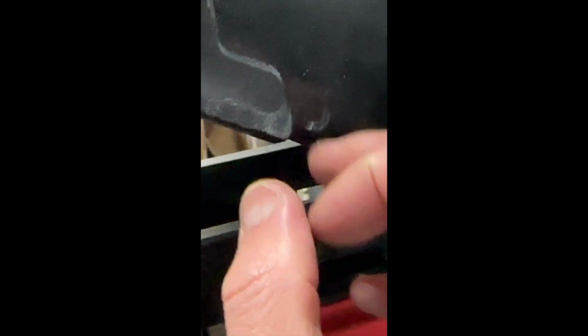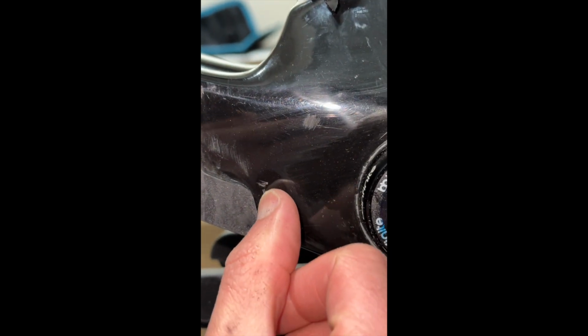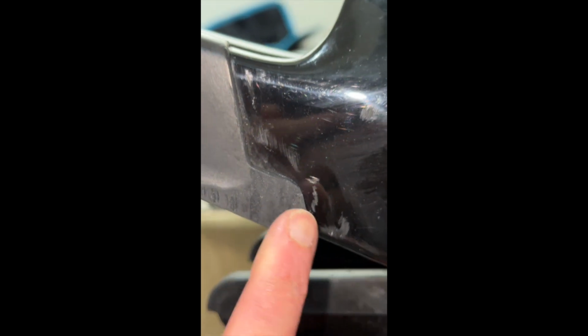So I have to figure out a way to loosen up this part. I already tried to polish a little bit, file a little bit, but it looks like I really have to trim down or even remove at least the tip, this part, so that it will stop rubbing the inner gear on the crank arm. So I used a rotary tool to trim this down quite a bit. Let me back out. I'm probably denting a tiny bit of my frame in the process. I should have put some tape on before I did this. But as you can see, it's trimmed down quite a bit.